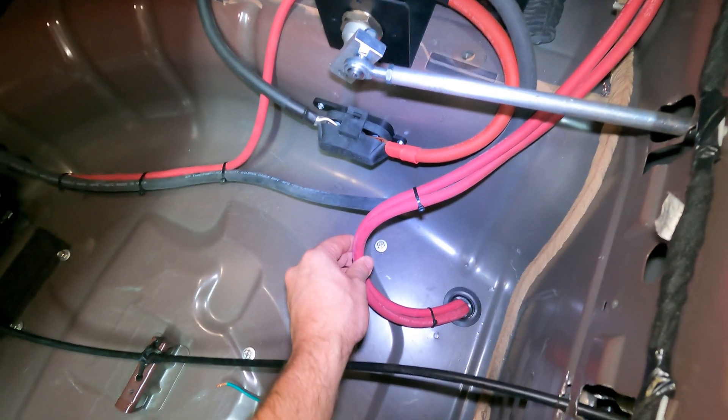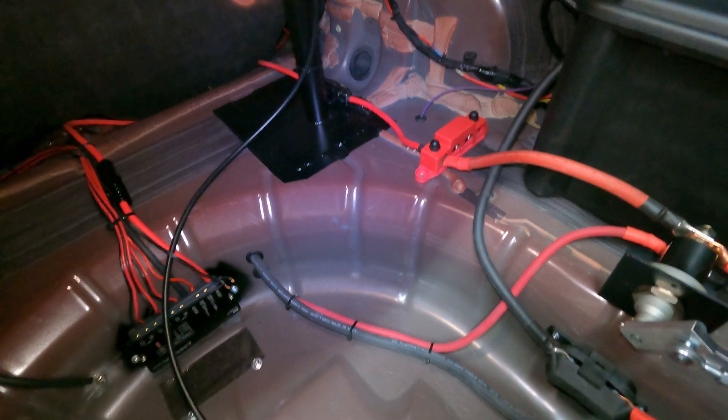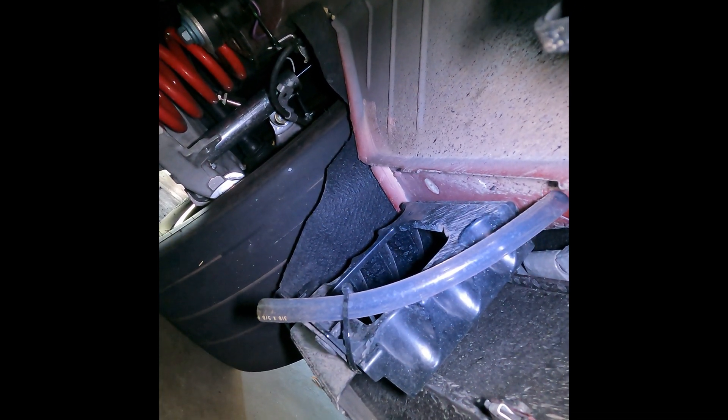The charging posts are also two-gauge, but everything else is double-aught with the exception of four-gauge wiring for the fuel pump. For the battery box mounting, I have it running through the flange part of the channel on the frame rail, so it's not just through thin sheet metal — it is through the flange part of the frame, the most secure location. That's what you have to do with a three-eighths or larger bolt to be NHRA legal. There is also a battery box discharge vent so that if something would happen in the box, there is a safe place for vapors to escape.